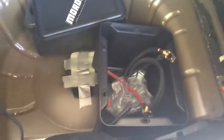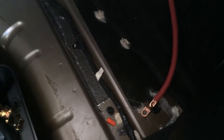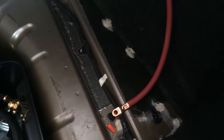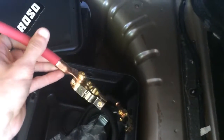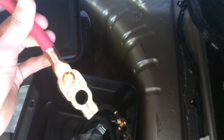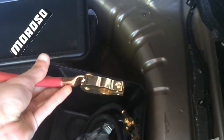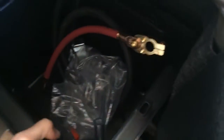For a little more space in the engine bay, I'm doing a battery relocation to the trunk, which I've already started. I ran the positive cable but haven't cut the other end or crimped on a terminal yet because I don't know exactly where I'm going to mount the junction box under the hood. I got the cables made up pretty easily — just crimped on a little terminal — they look pretty nice. I'll put some heat shrink on there, and the battery box is just going to go right up in the corner of the trunk. There'll still be a good amount of boot space.